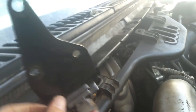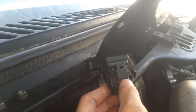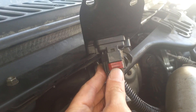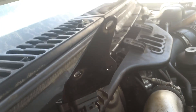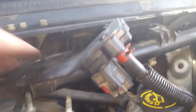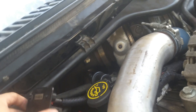One thing to note: I had pulled my plastic tab back so far that there was a little red plastic part I had to push down with a screwdriver to be able to move it forward. Be mindful of that — if you force it, you'll break the connector. Anyway, we've got the connector on and the hose attached. I'll use pliers to move the clamp into position, then route the wire back under here out of the way.